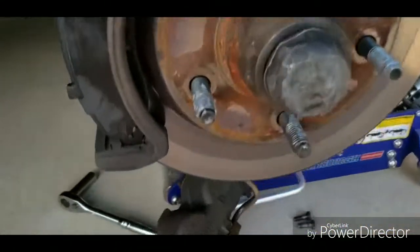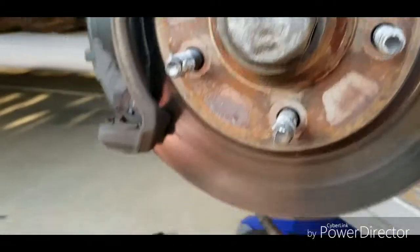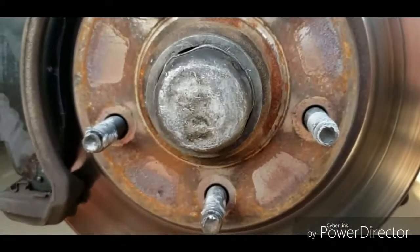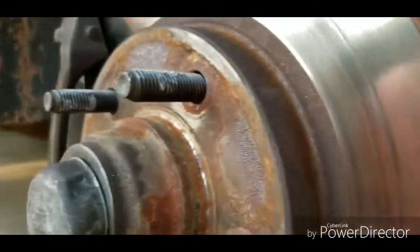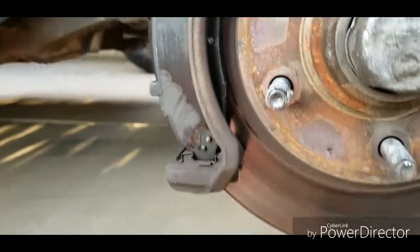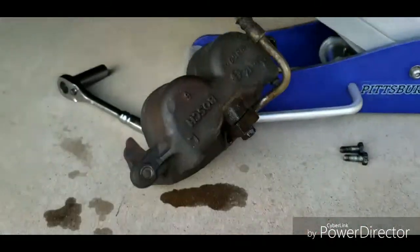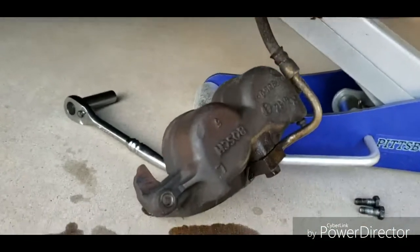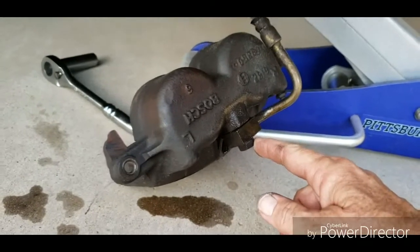The caliper is kind of jacked, so I need to take this caliper off. These are new rotors from like six months ago. The backup is kind of rough already, and it wore down the back brake pad because we think and suspect it is the caliper. So I bought a new caliper. I've got some goop on there to try to make that easier to open.